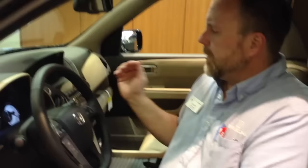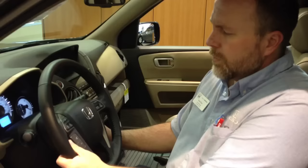What you need to do if this happens is grab the steering wheel and turn it the way it will turn. It won't go one way, but if I lift up, now I can turn the ignition switch. If that ever happens to you, just remember this tip. Thank you, and this is Darrell at Holmes Honda.